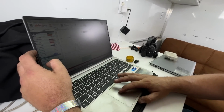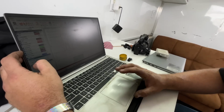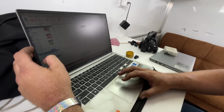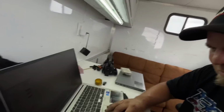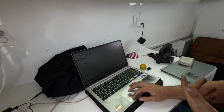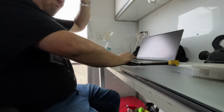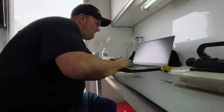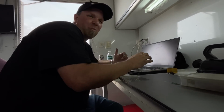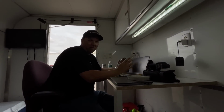That one EGT looks like it matches up now. Oil pressure, get down there. So our EGTs do match up. Right here, it dumped a four, because it tried shutting off. When the motor's at 900, it stopped. The motor basically stopped there. I'm going to open an old log, see what it makes preloading. It made the same. Your 9.0, it was making 8.9. So weird. You made the same boost, unloaded as loaded.